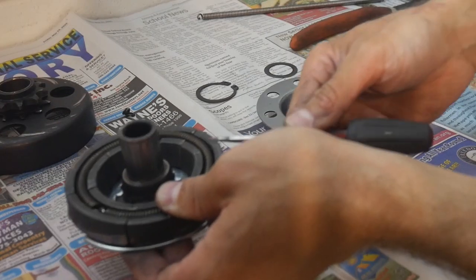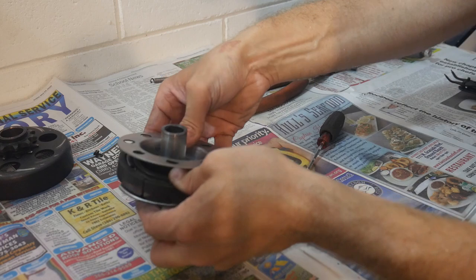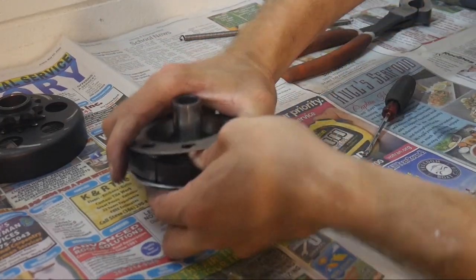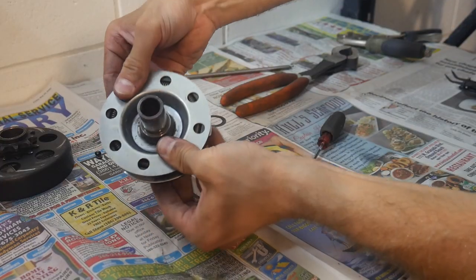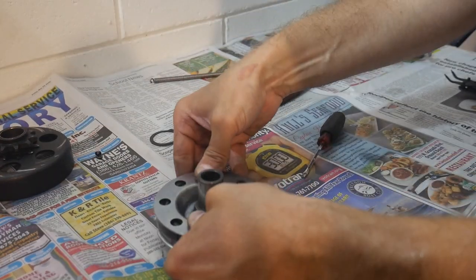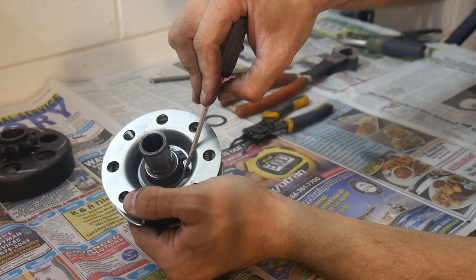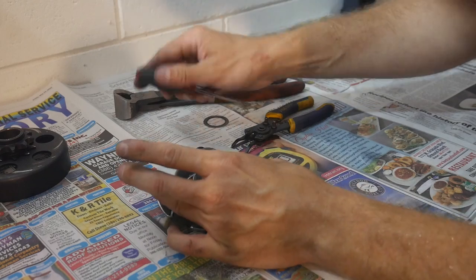And really, the best thing to do would be to maybe get a screwdriver underneath here. You want to get your top plate in, compress the one side of the top plate, and get ready to pinch this thing down and get your hand out very quickly. If you can do that quick like that, it should come together without this thing coming apart on you. What I like to do is get the one side of the clip under first, and then just work your way around with this. We're just going to give that a tap.